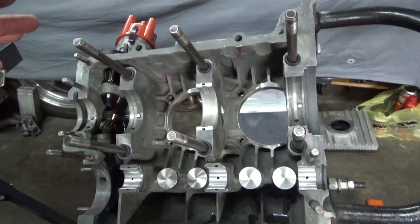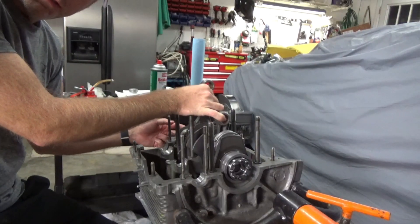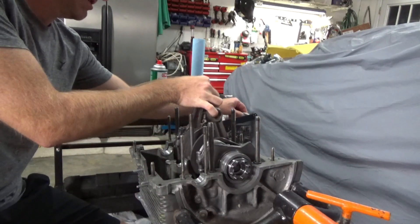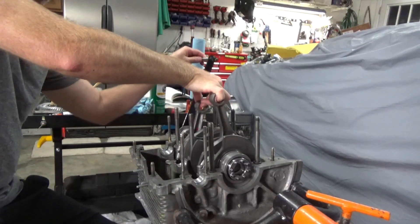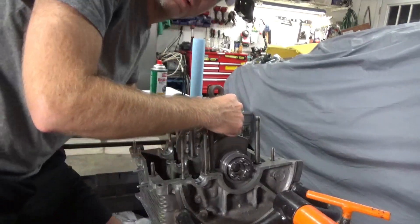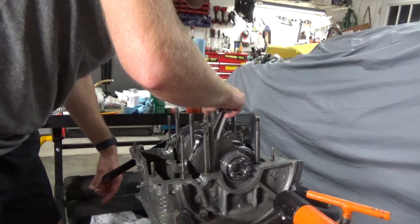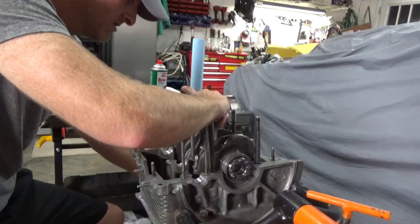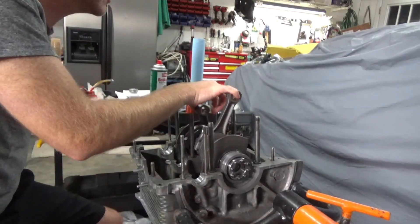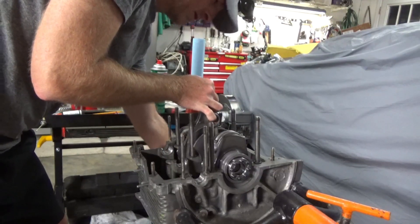I made a little lever by welding an old pulley nut and a bar onto a middle handle, so I'm slowly rotating the crank and keeping things centered to check for interference. I have a couple of close ones but it is clearing by plenty, so I'm going to call this side of the case successful. I'll get it back around to top dead center — that's another good reason to have your distributor in place, so you can verify TDC.